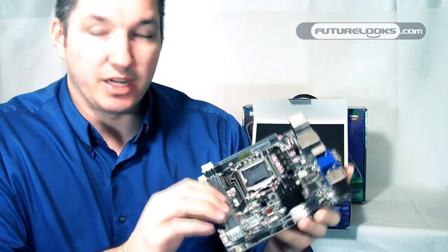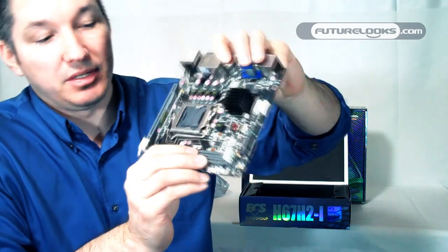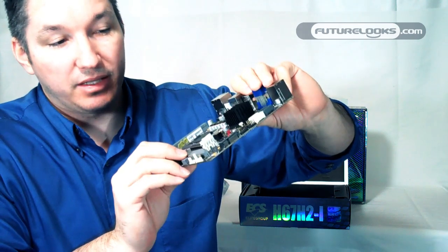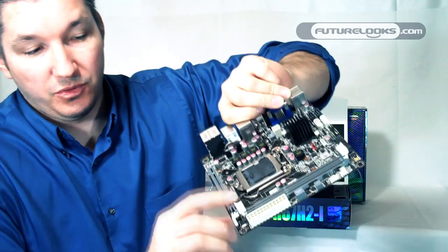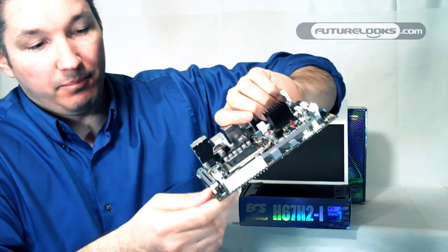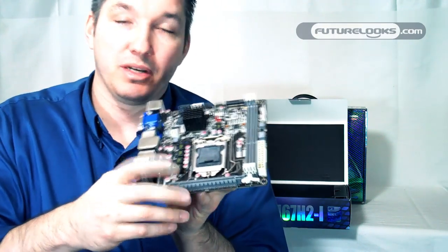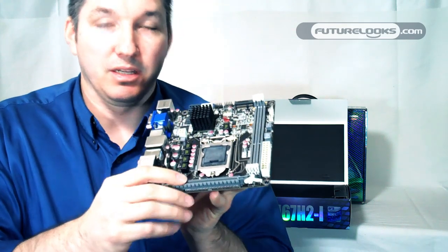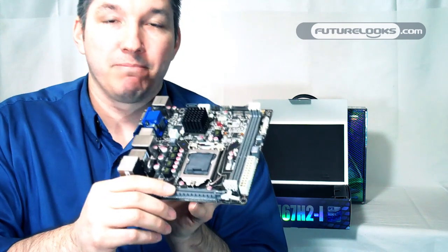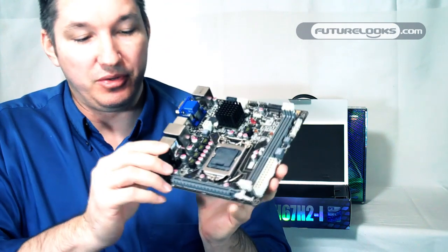Typically these support just standard 1333MHz, although 1600MHz would easily be offered as well - just back the timings down and the frequency. Then there's your full-speed PCI Express 2.0. As long as your case is large enough to fit whatever video card you put in here, you're good to go. In the case of the Silverstone SG07, you can house a GTX 580, especially since it has a 600W power supply.